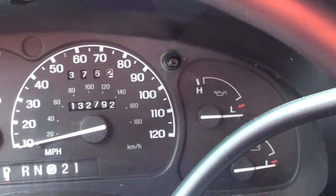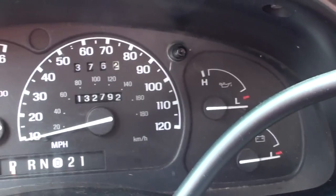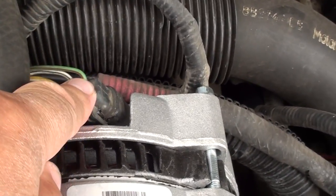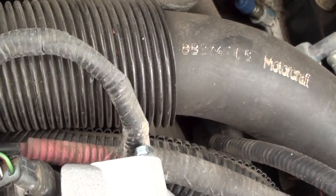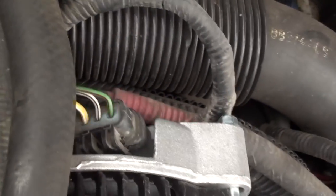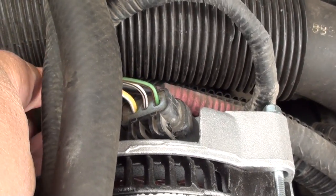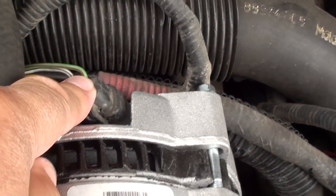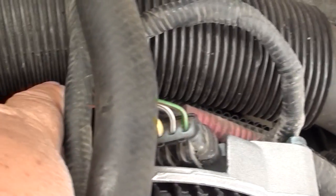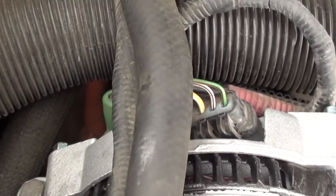So through questioning everyone I knew, here's what I found out. We popped the hood and went to the back of the alternator. Make sure those connections are plugged in all the way — it sounds simple but they can pop out. Just push down on them with your finger with the car not running. You can also unplug them, make sure the plugs look clean with nothing bent or rusted, and spray some contact cleaner in there. Mechanics are human too, so it's worth double-checking.